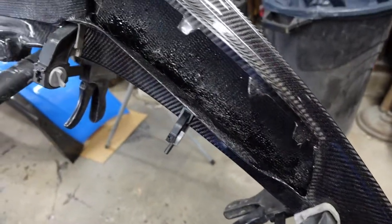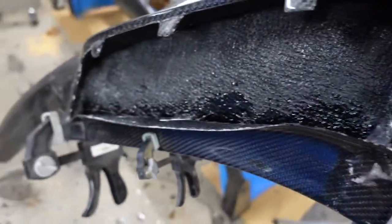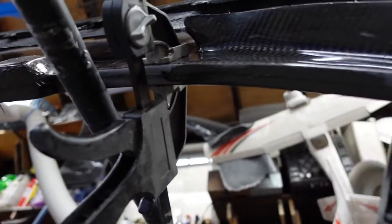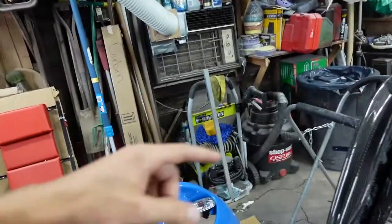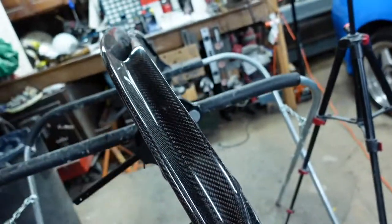Step one is done — we have this now curing. What I did was lay my resin in, took my fiberglass, laid the fiberglass in resin over that, and then down here I put an extra layer and added a little bit of carbon just to give that middle some rigidity, so when I go to flip it, it doesn't start to bow out and re-crack. Now I'm going to have to do the same thing to the flip side.